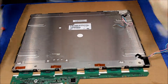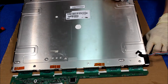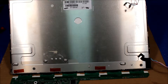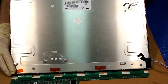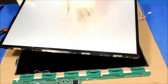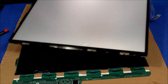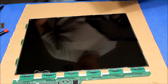Flip it over and just pull this thing out. It was holding the glass. We had to remove that glue — use the blade, just be careful. The way we use the blade: go here first, then tilt a little bit, just like this. But don't go too much, one at a time. If you don't be careful, you're going to crack the glass. There's a small glue — that glue in the liquid glass.